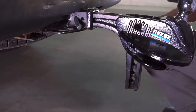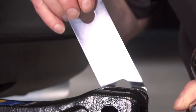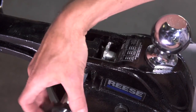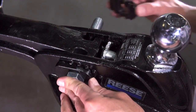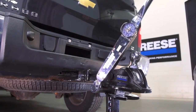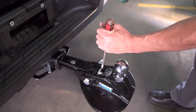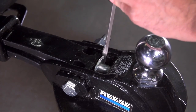Install the lower and shorter bolt assembly. The SteadiFlex comes with two shims to help you tighten faster. Once you have the height set, install the top bolt assembly including the hex bolts, tooth washers, lock washer, and hex nut. Make sure the tooth washer is in the preset location as shown, then torque the fasteners to 300 foot-pounds. Rotate the adjustment bolt counterclockwise until snug, then tap it another one-quarter to one-half turn.